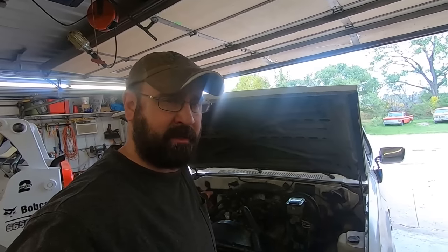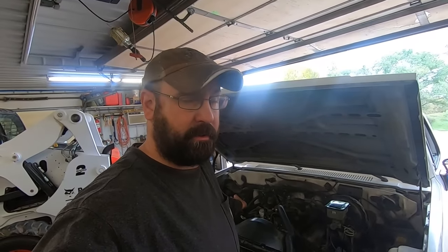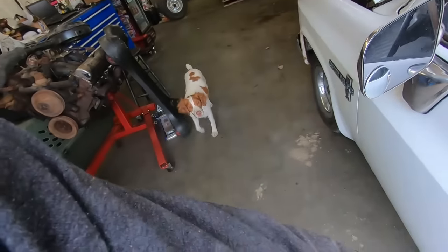I don't usually see this on automotive engines, usually on snowmobiles where you got multiple carburetors, but this bank was pretty lean and that bank was not so much. Two of the plugs over there were pretty loose too. Plug wires didn't look so bad, but we had them, so we stuck them on. Think she's gonna run better now, Duffers?